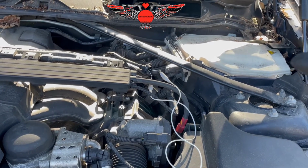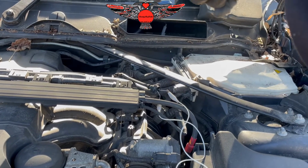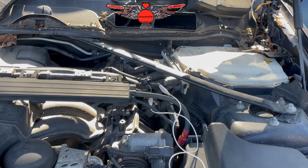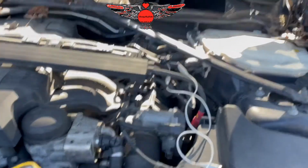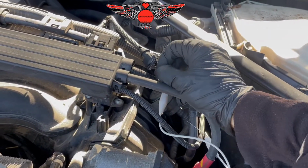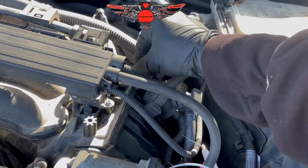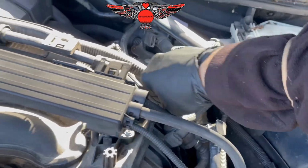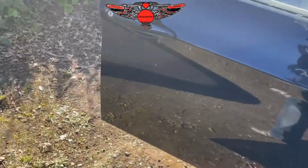And if you didn't have any voltage there and you notice your wiring is okay, then you want to go and check the fuse. So in my case, obviously it was a wire situation. I can reconnect the valve and happy days.